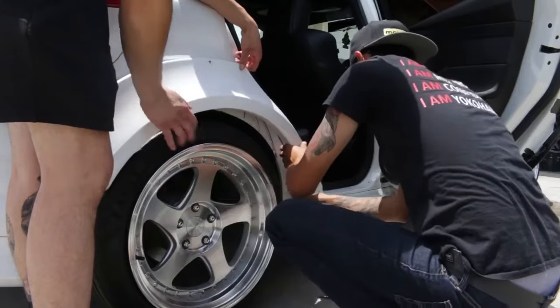This is what we were talking about. These little metal brackets that we have spaced in here to flex out the flare so that it puts rigidity behind it, as well as makes it meet up with the other flare when you close it so that it's the same. You see how it lines up, and the only thing that's the difference is the panel gap for the door. And, yeah. Perfect. This side came out way cleaner than the other side.